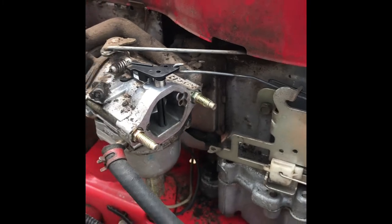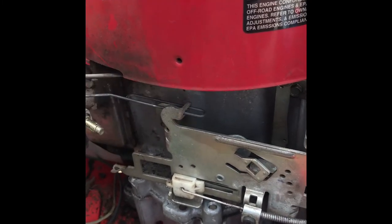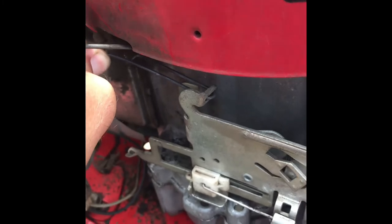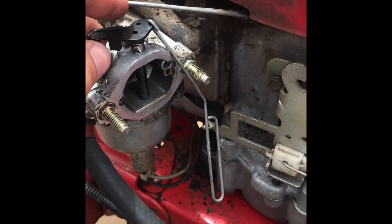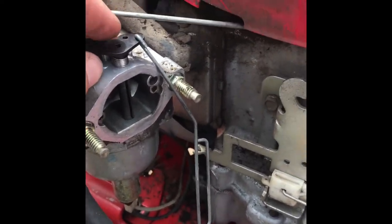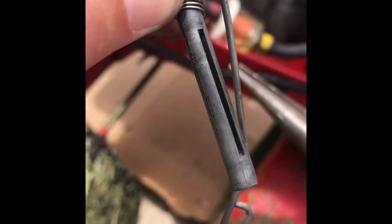Now I need to get this guy out right here. I didn't want to take my entire carburetor off, so what I'm going to do is open it all the way up so I have the smallest piece right here, and right where it bends I'm just going to put a little extra pressure on it until it pops out of place. The back popped out right there. Now with this black piece in my hand, make sure you're still holding all of it — it has spring tension, that's what's supposed to make it open and close. When I first took this off and it was dirty, it was just staying in place; it should be trying to go back closed. Now that I've taken the metal plate out of the center, this can lift straight up. There's a spring right here — just make sure you don't lose this spring. The whole thing will come right out. You'll probably have a little bit of tension on yours as you pull it up, right here on the bottom of the black part, and that's what we're trying to fix.